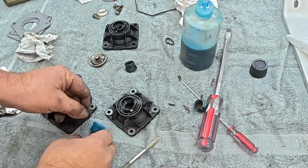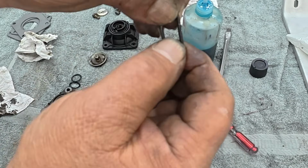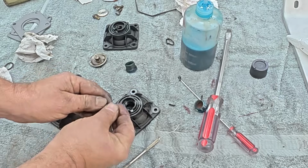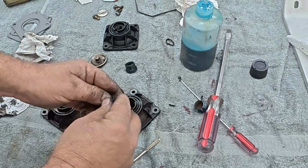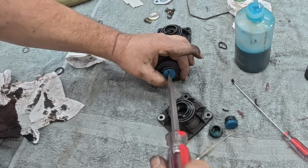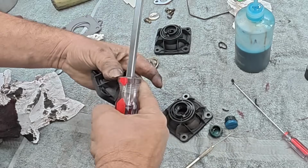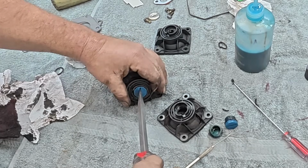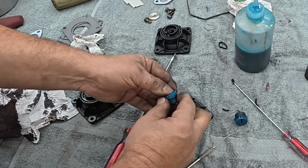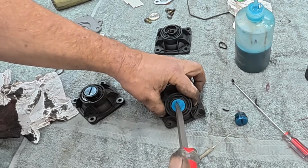All right, got my 3 new O-rings, which is pretty easily told because 2 were broke and 1 was almost broke. So the 3 fresh ones are easily identified. We're going to set these flush because that is what the manual recommends. Flush for trail riding. Says you might tighten them up for drag racing. If you don't have a factory service manual, highly recommend you purchase one.